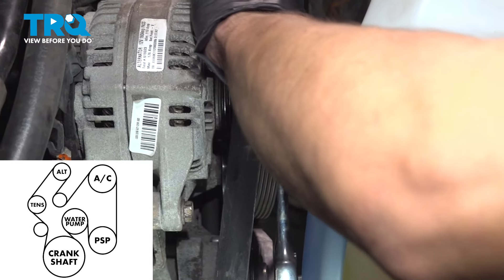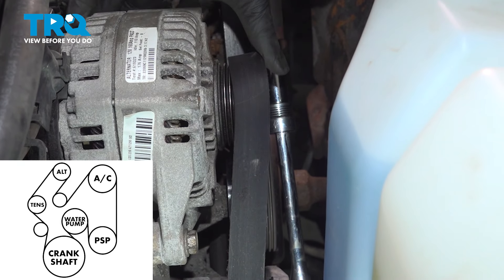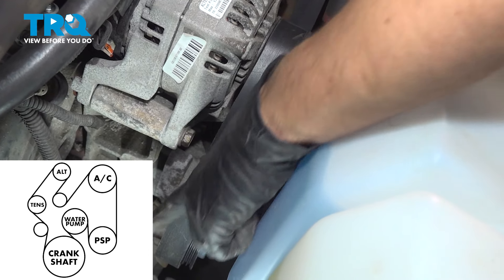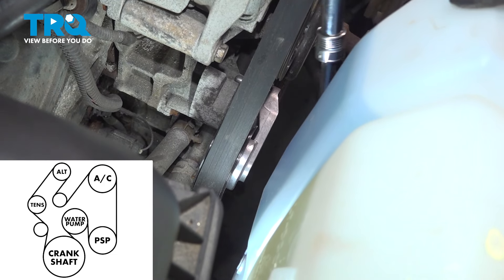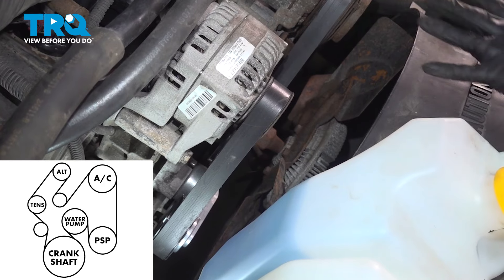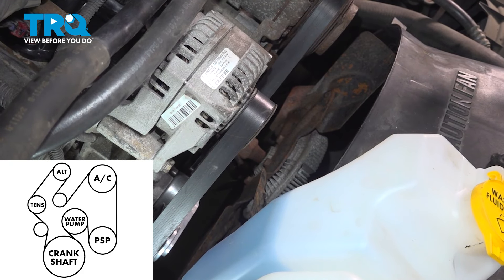Ideally route around the idler since it's a flat pulley, but the alternator works too — just makes it more difficult because of the ribs. Always double check your pulleys; as you can see, this one is not lined up, so put it back on correctly. Double check everything else before you call it done. Do check again after you turn the engine on — turn it on for a couple seconds, shut it off, come back and check. At this point everything looks good.